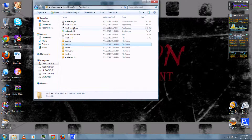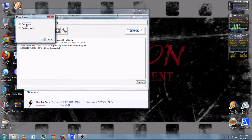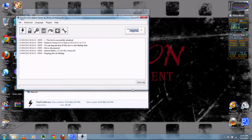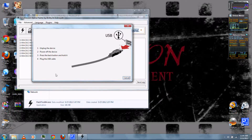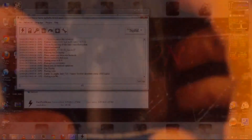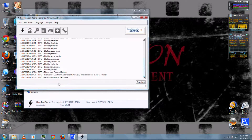When that's done, go back to the Flash Tool folder and run the Flash Tool .exe — the actual app. Click the lightning bolt, then go into Flash Mode. Select the R800X from Verizon. Be sure not to wipe your data — uncheck that box. Then follow the instructions to unplug your device, shut off your device, and hold the back button while you reconnect. It should start flashing your phone automatically. This will take a while, so I've sped up the video clip.